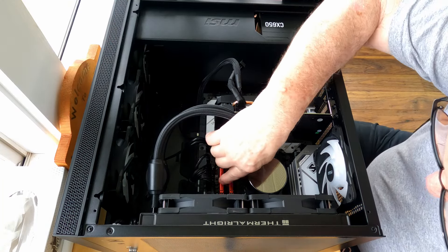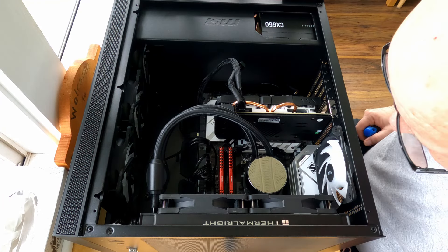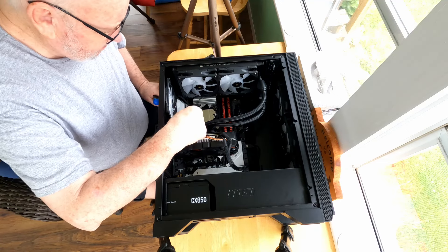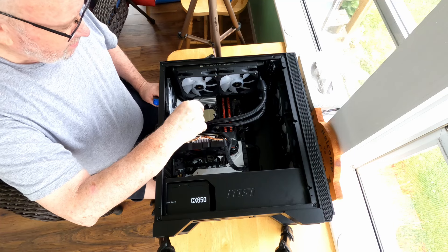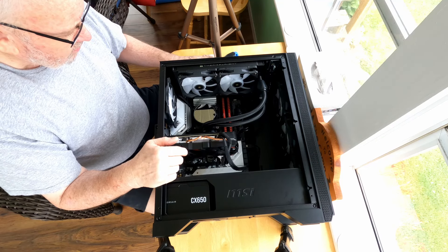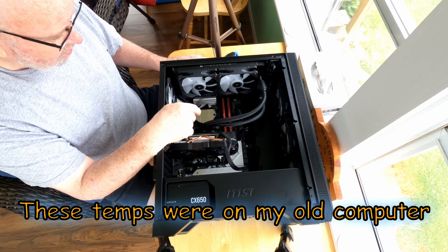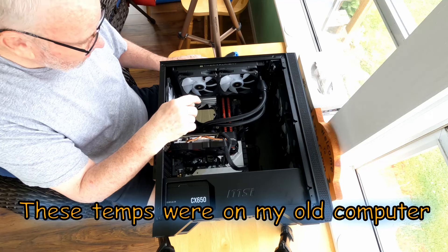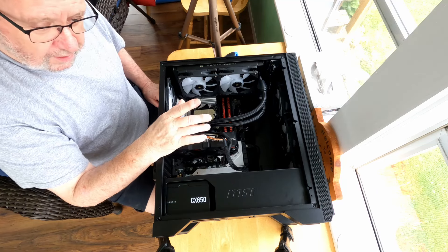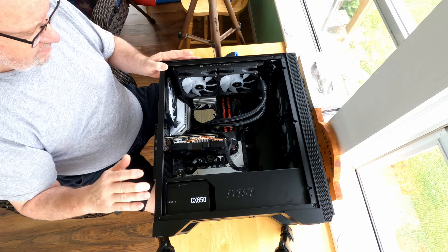These red things down here are the RAM — all computers need RAM. Those are 8 gig sticks so I've got 16 gigs of RAM. The other thing I was concerned about is that this is a 10th generation i9 processor and it generates a lot of heat when it's working, even just editing a bit of video. The processor temps were getting up around 90–95 degrees C, which is pretty warm. So when I had the opportunity to get this motherboard and a beefier processor, I thought I'd make sure to get it well cooled.